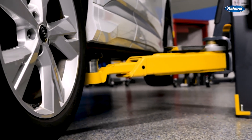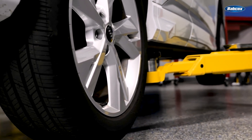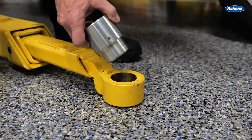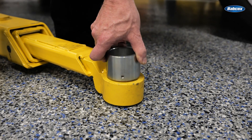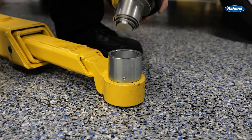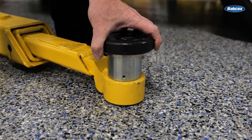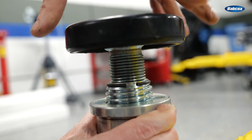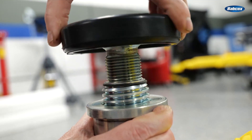If you're using a two-post lift, make sure the arms have a low enough profile and can extend and retract far enough to access the OEM recommended lifting points. Having a variety of adapters available is helpful. Although flip-up adapters are convenient, screw pad adapters offer more precision. Some lifts even have a dropped-end adapter receiver to get under the lowest profiles.